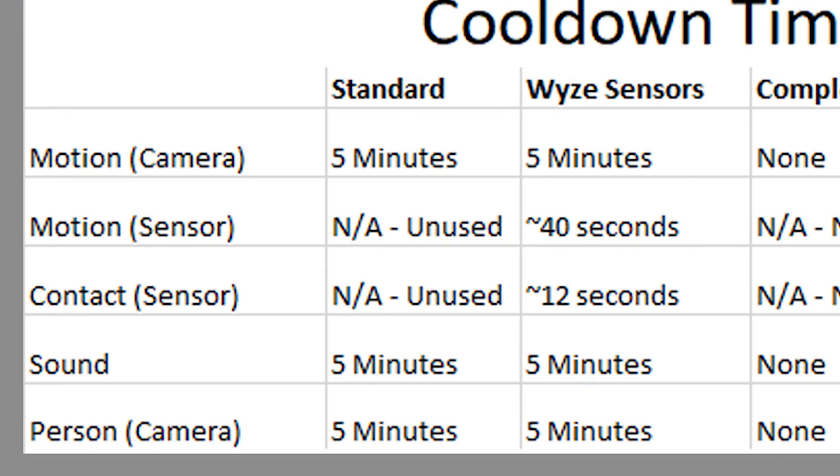The contact sensor is in many ways more powerful than even the motion sensor, because it doesn't really have a cooldown. The only cooldown the contact sensor has is actually how long it takes to record the first video. So if you trigger a contact sensor-based recording, it's got to wait that 12 seconds before it can start another — that's your only limitation. It can be very powerful in terms of triggering those sensor videos. If you have complete motion capture, you've just recorded for a minute to the cloud, so then that's how long you have to wait to have another trigger of either of those two sensors.